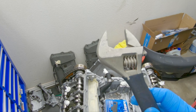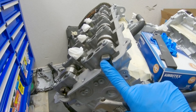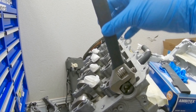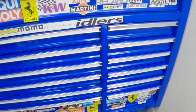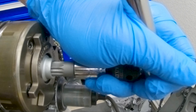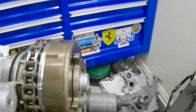It still can be done — you can use a wrench or a crescent wrench since the wrenches I have are not big enough. I believe this is a one-inch and since I do not have a one-inch I'm going to have to use a crescent wrench. On one side I'm going to have the crescent wrench right here, and on the other side these are going to be the mechanical adjusters. I'm going to use a 14 millimeter triple square with a breaker bar. It's already loose because I did it beforehand, and while you are loosening this going counterclockwise you're holding this straight.